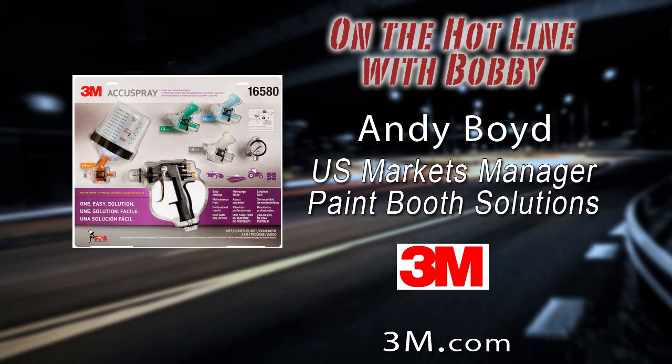A 1.4 is for more of a medium viscosity, maybe a single-stage paint, sealer, or lacquer. And then the 1.8 millimeter is for a lot of your primers and heavier viscosity materials. They're all different colors so you know what size it is — a very easy way to identify what you're changing out on the same gun platform. From a cup perspective, you get the hard shell cup, and like a baby bottle, inside you get five disposable lids and liners. The spray gun kit can get you from start to finish, and also includes an airflow control valve. We like to spray at very low pressures so more of your paint and coating goes on the substrate, rather than ending up as overspray standing in a cloud in the garage. It's an all-inclusive kit.